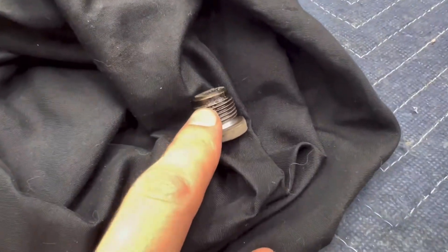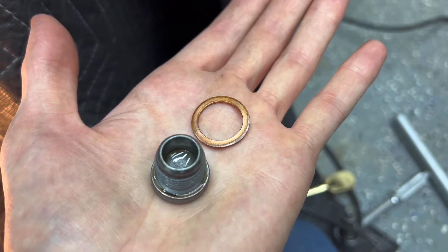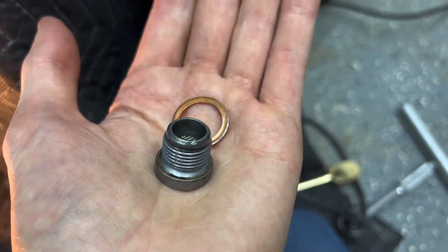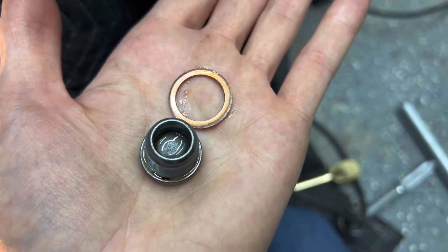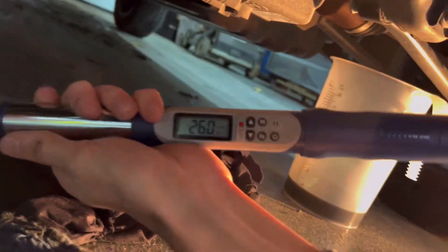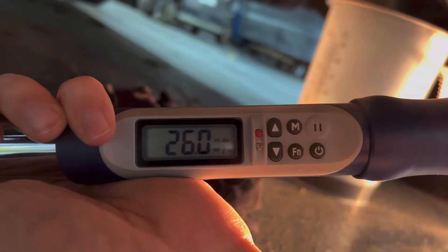Go ahead and wipe off the metal slivers from your oil drain plug magnet. Both the drain plug and the fill plug have this brass-looking washer — keep an eye out for it and don't lose it; it might stick to the housing. Using your 10 millimeter Allen on a socket on a torque wrench, we're going to torque our drain plug to 26 foot pounds.